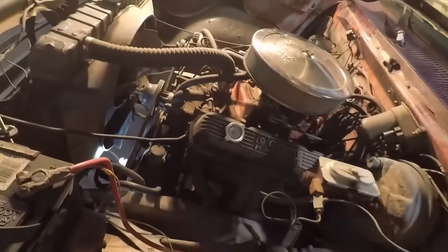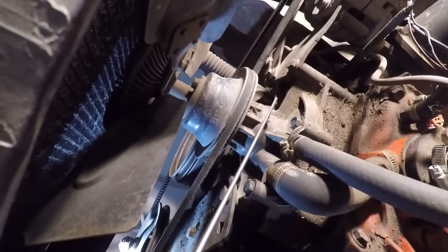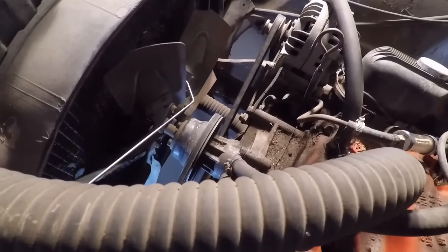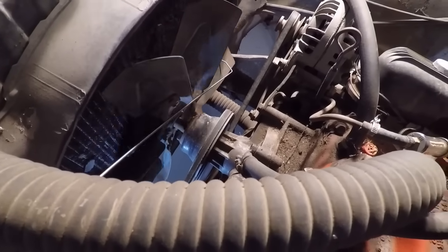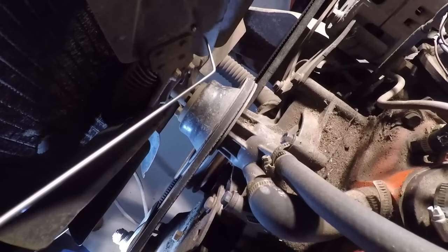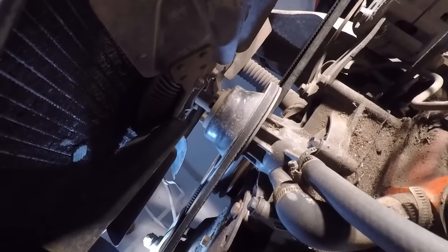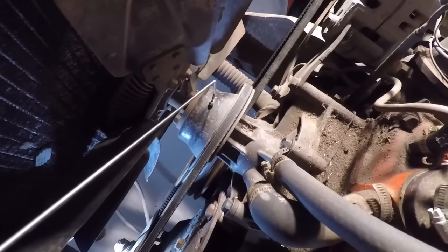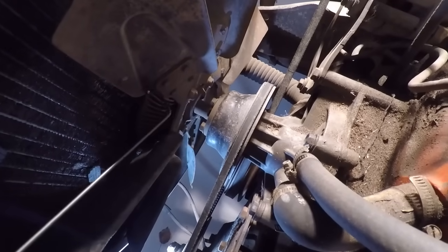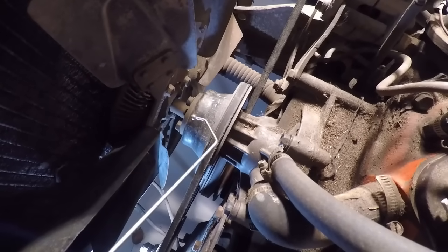Tech tip number three: the next thing that's robbing horsepower is this water pump. It's driven by the crankshaft through a belt and draws horsepower to turn your water pump to keep the coolant running through your block. What draws the most horsepower is your fan, and if you don't have a fan clutch and you have a fan that's tied directly to your water pump, you are drawing excessive horsepower going down the road. So if you have a direct fan tied to your water pump, get rid of it. Get a clutch fan — it'll gain you horsepower and fuel economy. If it has a direct fan bolted directly to the water pump, someone's changed it. You need to go buy a fan clutch and a new fan to go with it and put it on. It'll be money well spent.